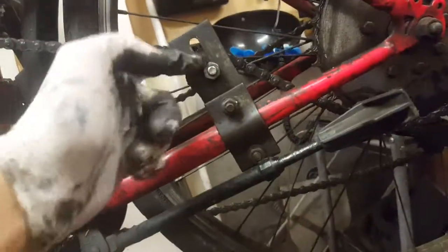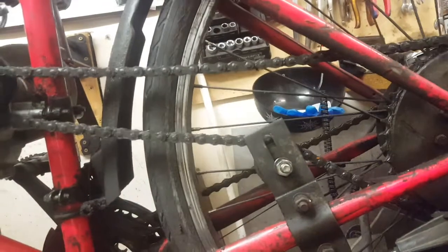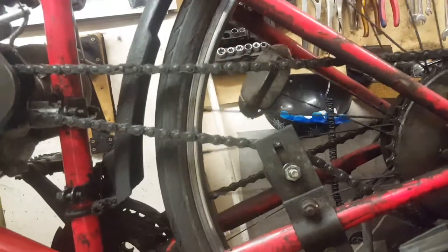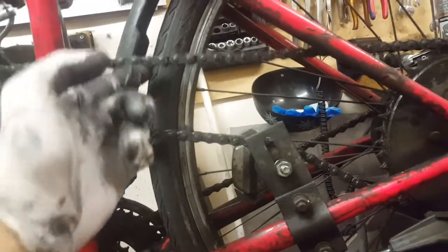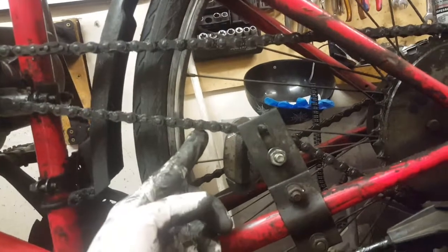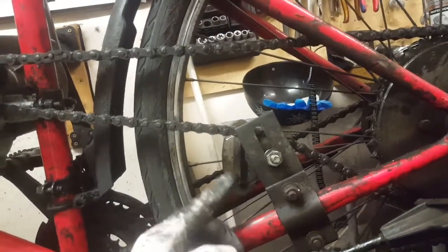But what you have to do is find the right point when it's tight, not when it's loose. For example, now, to tighten the chain idler, you have to just rotate 360 and find the tight position, like this. So okay, now this is the point, the tight point. So now is the time that we have to tighten the chain more.